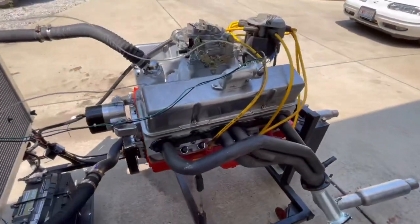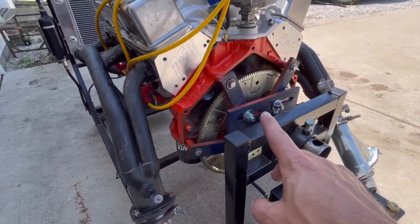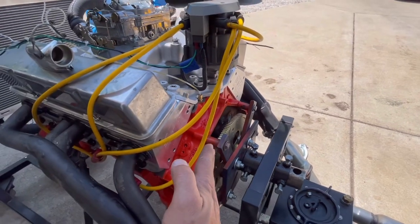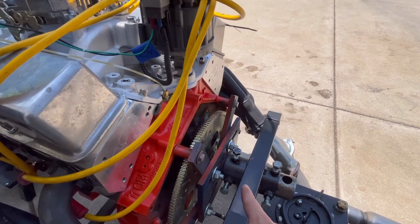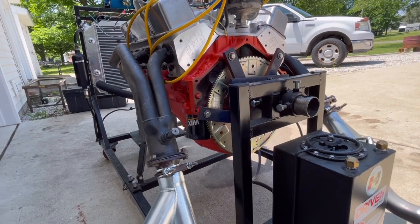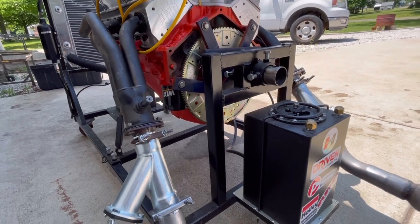Here's the cool part — come back here and take a look. This is an engine stand head. Basically this is one solid piece. Take it off the stand, put your flywheel on, bolt this back on, slide it back on, and lock it into place. It's real simple and easy to do. The nice part about it is if we need to pull this off, we can take this and put it directly on the engine stand. Another step of efficiency.